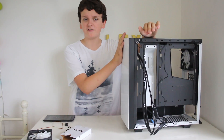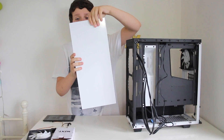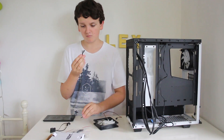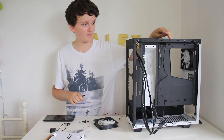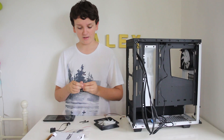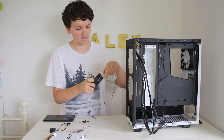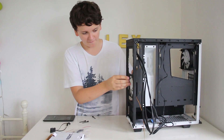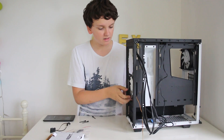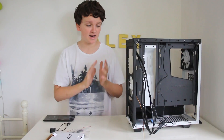To start installing the fan, you have to pull the front panel off — this is probably the nicest part of the case, so be careful. Grab it from underneath and pull it off. It comes off with a bit of ease and there are little plastic prongs that keep it in place, so don't do this too much or those prongs may wear out. I've bought rubber mounting pieces to remove fan vibrations throughout the case and make it quieter — they cost about £2 for a pack of 20 on Amazon. Take one rubber mount, orient the fan the way you want it, slot the cable through the convenient hole, push the rubber mount through the fan mounting points and pull it through until the fan is mounted to the case. Repeat for all four mounting points and then that fan is done.